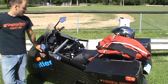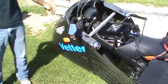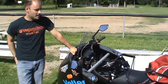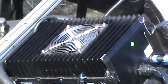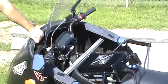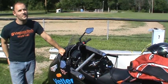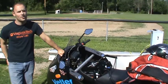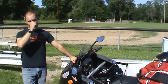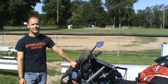So you've got a big charger there — is that stock? No, this is not stock. This is an Elcon on loan from Hollywood Electrics. What does that do for your charge time? Instead of charging at about 1.5 kilowatts, this is now a 2.5 kilowatt charger, so in total I can actually charge at like 3,500 watts. So you're more than twice as fast? Yeah, that makes it quite a bit nicer to stop somewhere and actually charge.